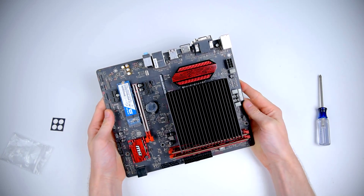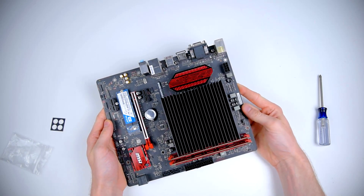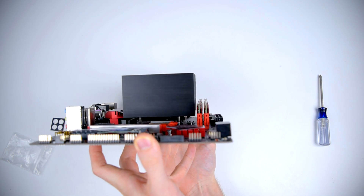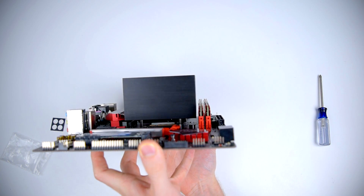After getting the mounting holes on the motherboard aligned with the threaded holes on the heatsink, I tightened the screws in a crisscross pattern so it wouldn't bend the motherboard as they get clamped down. With it installed, you can see it's a pretty large chunk of metal, but fits very close to the socket. It also sits completely separated from the RAM slot so memory clearance won't be a concern. I'll be testing it with the Ryzen 3 1200 at stock speed and voltage which comes out to 3.1GHz at about 1V while running a stress test with Prime 95. Total power draw for the CPU at this speed is right around 50 watts, so slightly over the rated TDP for the cooler.